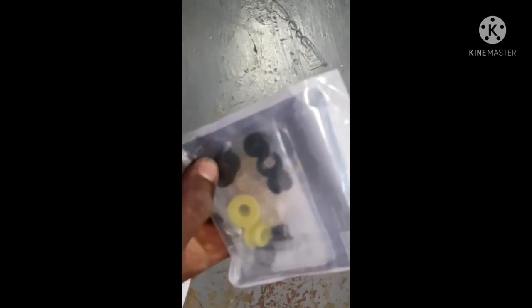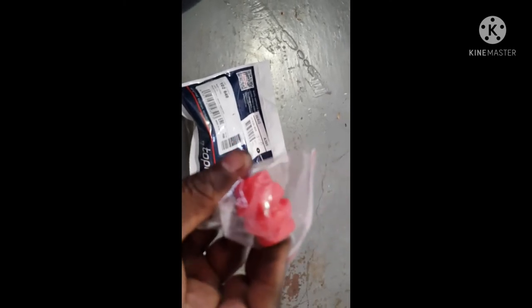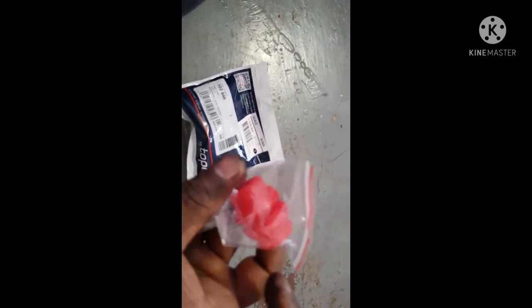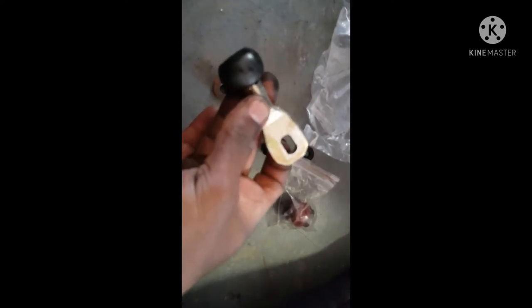So this is a bushing kit that I actually got from Goldragon. As you can see, all the bushes are there. This is the red bushing that I showed you originally on the bracket where that shaft moves front and back through. And these are all the other linkages. So I've got a used set here that I did take off previously. This is that lollipop that I spoke about — as you can see, it's got a keyway in it so the shaft fits in there. So when this moves front and back, it actually spins the shaft.